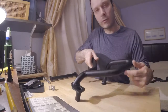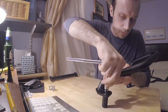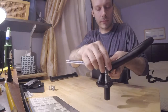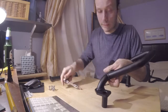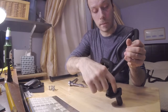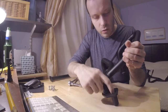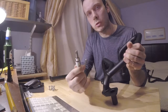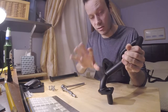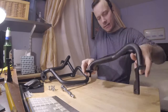I tried that and ran into a problem: this bracket doesn't fit perfectly. At least one side fits, so for the purpose of this video I didn't file that one — but I had to file this other one. The welding is sticking outside, and I had to file it down to make it fit properly, because we're talking about mounting it to the engine bolt and torquing to specification.